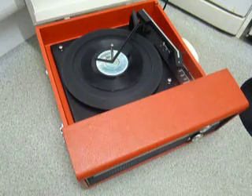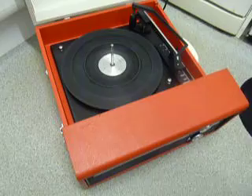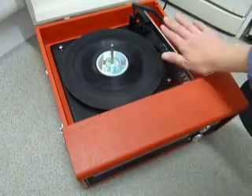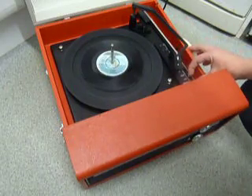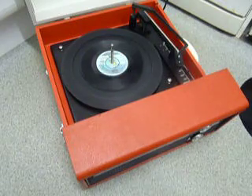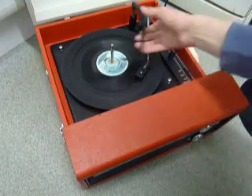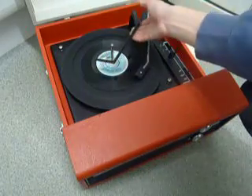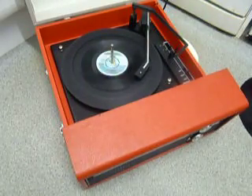If you don't want to use the automatic feature and just want to play records manually, you can pop a record and wiggle it down the spindle onto the mat. With the stacker bar in the upright position, flick the switch to auto and the arm will go across. Then lower the stacker bar down so it knows to switch off at the end of the record. If you leave the stacker bar in the upright position, that triggers a repeat function and the same record plays over again.